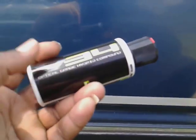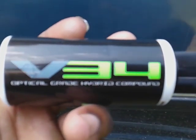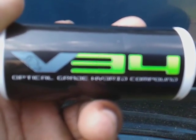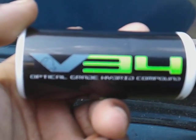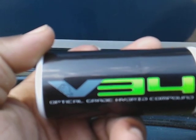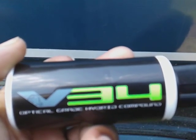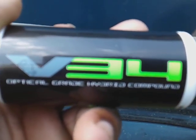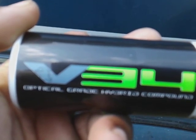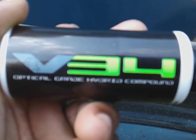You don't really have to take my word for it — this kit was $20. If you just want to test it for yourself for $20, go ahead and grab it. Can't go wrong with the V34, it still works amazing as you can see — brings back the shine. Now, this one takes out severe defects, so if some of you guys have never really worked with compounds or haven't worked with anything too aggressive, give it a try, but note that this is for severe paint defects. If you've never worked with compounds or you're using it with a machine, it's gonna cut really fast. Using it by hand actually does the job — when it had to fight a machine, that's how fast this stuff cuts.